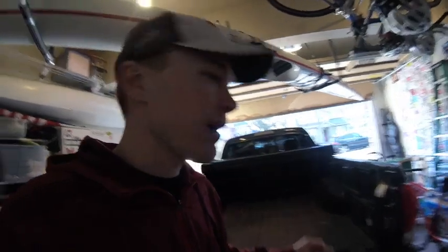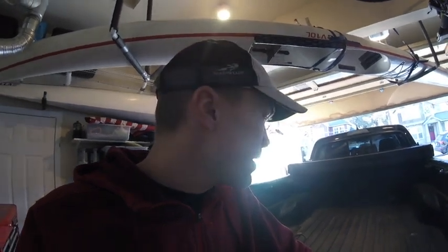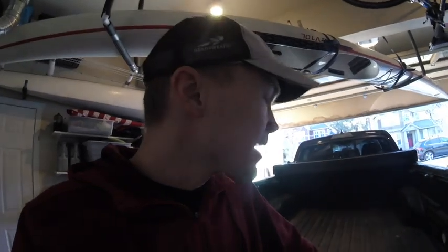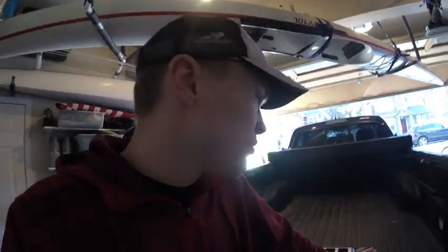Could come in really handy, especially nice in a pickup, just because typically you use them for a lot of little projects where power can be very handy. And so a nice feature to have available. Just to summarize, when the vehicle is off, you've got 100 watts total capacity. When the motor's running, you've got 400 watts. All you've got to do is either turn the ignition on or turn the vehicle on, push that button on the left-hand side, and that'll turn the inverter on, run the bed outlet, and you're golden.